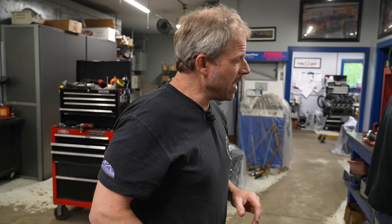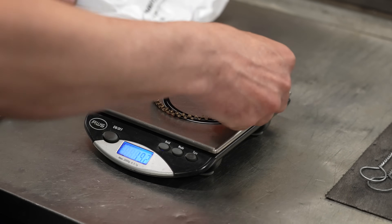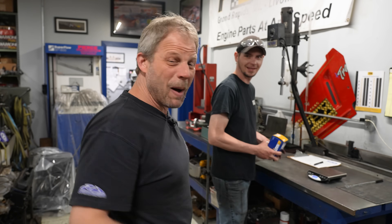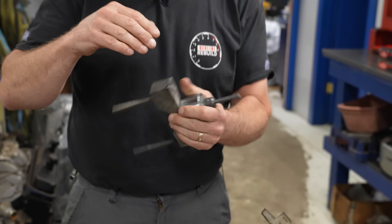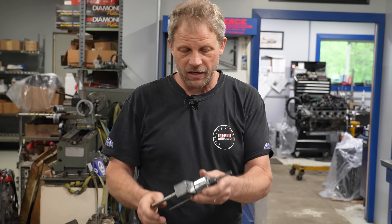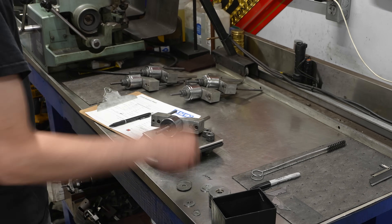John has the rods all balanced - big end, small end, everything is exactly the same. Now we're moving on to measuring just the rings, so you want to know what the weight of the ring pack is going to be on each piston. You also include the bearing because that's part of the rotating assembly. This assembly is referred to as the bob weight and it represents the weight of the rod and piston assembly including the rings, bearings, and wrist pins. When you go to spin the crankshaft you can't have the rods and pistons flinging around, so you control it with the bob weight. Now that we have the bob weight set, it's attached to the crankshaft and we can spin it.